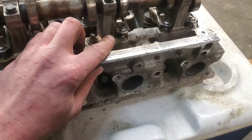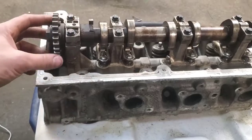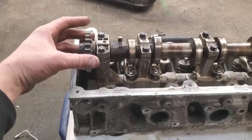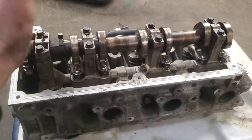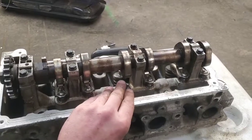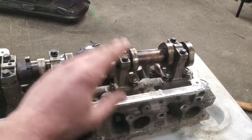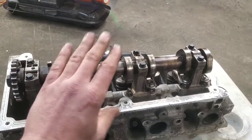So I said, let's figure out what's going on here. I loosened up this timing chain, put the engine over to top dead center on number one with the crankshaft before pulling this apart, removed this camshaft, put this roller back in place - and that's when I found my mistake. Even though your engine was running good at the time, you could still have issues, and that's what we want to point out here.